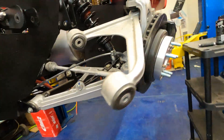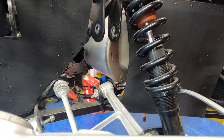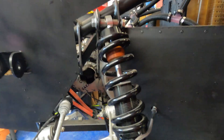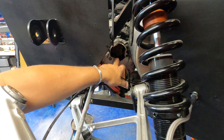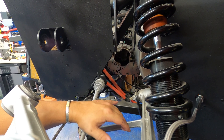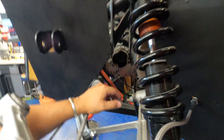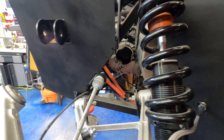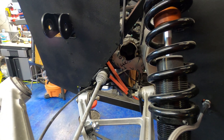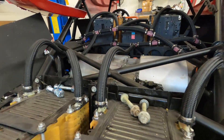I've got some paper towels stuffed in the axle outputs here while I wait on custom drive shafts. Tesla uses a funky metric spline for the inside of the drive shaft where it meets the CV joint — you can see the cup in this one. Really all I'm having made is the axle itself. I plan on using the original Corvette outers and Tesla inners, and hopefully the Corvette outers hold up. The outer portions are completed and they were waiting on tooling to meet up to the inners.